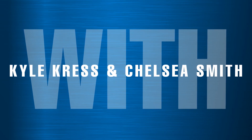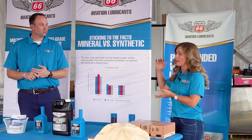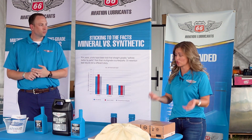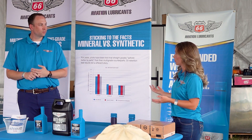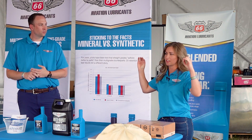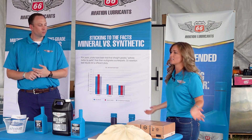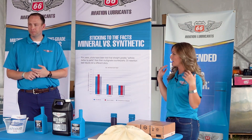Because I'm out of town, it's summer, it's hot, it's humid, my plane's sitting on the ramp. There are different levels of pickling your aircraft to preserve that engine and prevent rust from happening. Even if you just get the smallest spots of rust, once you start running that engine again it's going to start shaving metal because that surface is sacrificed.